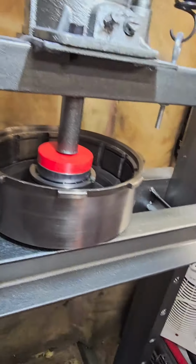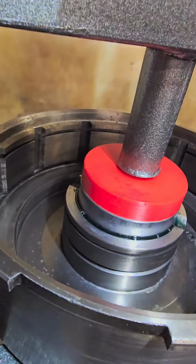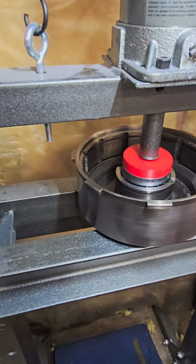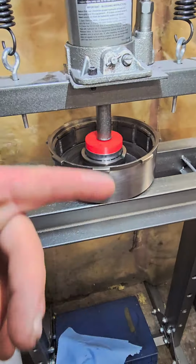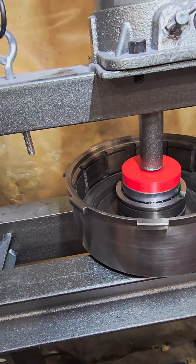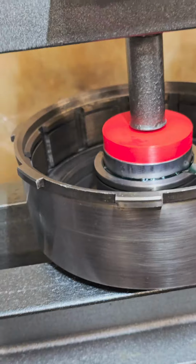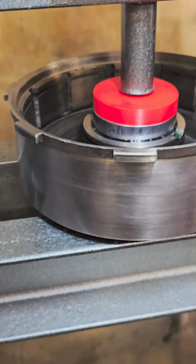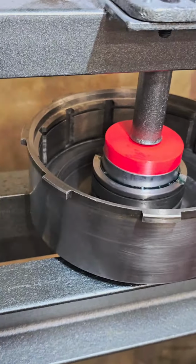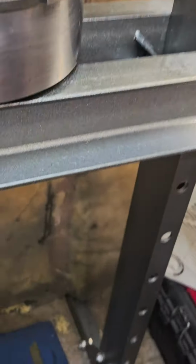I always mess up one of these bushings because they got a little puzzle piece right there, and I usually opt for the Durabond one-piece bushings, full round bushings. But lately they've just been on back order, so I have no choice but to use the OEM Chrysler bushings. But typically I use the Durabond bushings, and they're so much nicer, made in the USA. I don't know where these things are made, but anyway, I got some sleeve retainer compound on there, a copious amount, because I want that bushing to stay in place, and I don't want any fluid to get behind it.